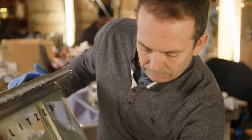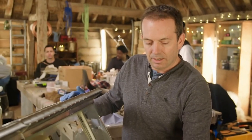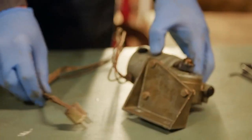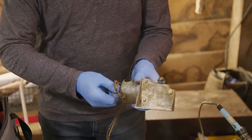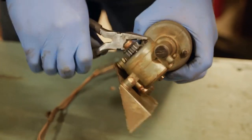It shouldn't be making that buzzing noise. As soon as I press a letter and a number button, it should select the mechanism and it should start spinning around. I've taken the motor off and it's really difficult to turn the spindle, which is this piece at the end. And that tells me that it's seized up inside. It should be nice and free.